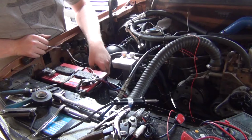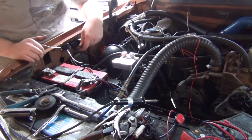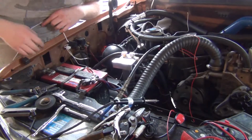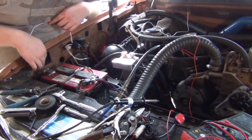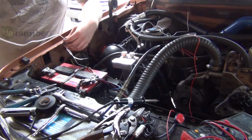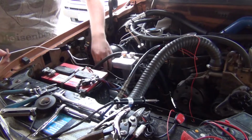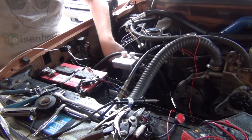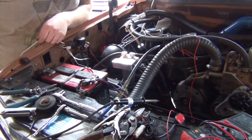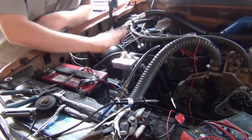The connector here for our ground, it's all soldered up. I just need to wrap it. And then lastly was just these two here. Oh, the little skinny black ground, he's going to this ground here for the headlights. So the relay ground, we're good there. So this skinny white wire, we're gonna trace him somewhere over here, and then hook up to my little yellow wire I got over here for my key on. And then that should, when we do key on, activate the relay and switch the ground over. And this thing will run.